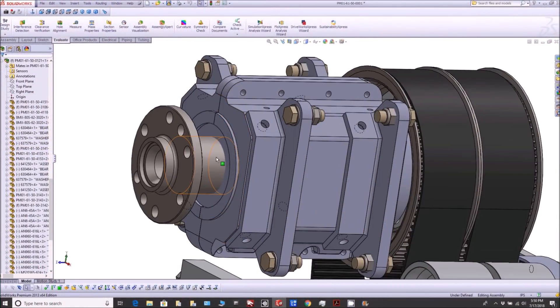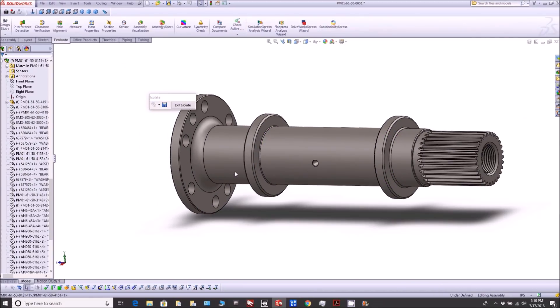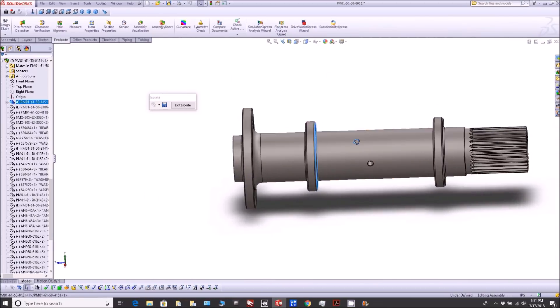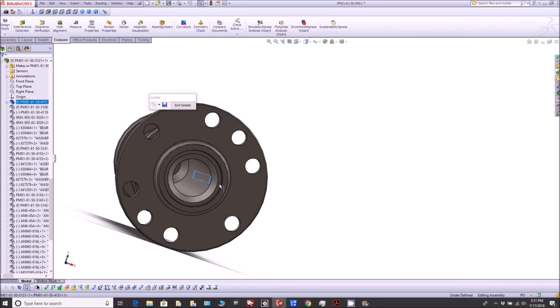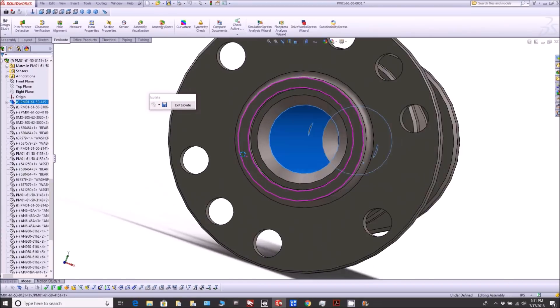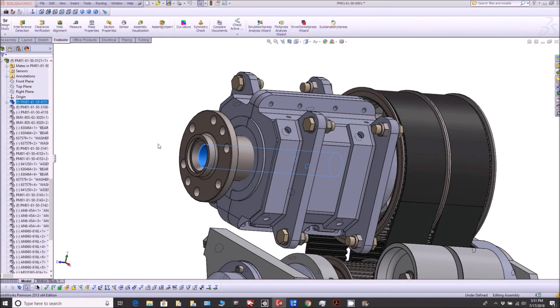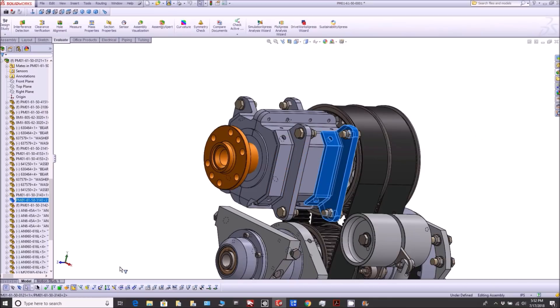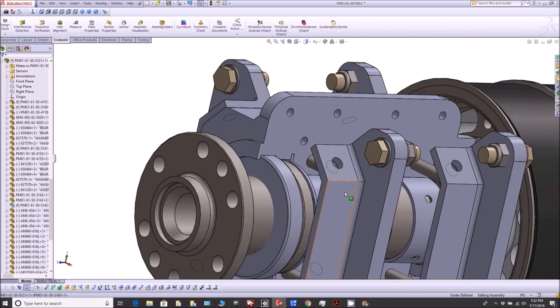Moving on to the re-drive — here's where it looks right now, pretty much finished in terms of all the design aspects. There's the new prop shaft, slightly different than the previous one. These nubs support the thrust — those are the thrust ones, where the thrust washers push up against. There are the oil feed holes, and the oil comes back through the center into the prop for the constant-speed prop. That shaft has been sent off for machining and we should have it back in about six weeks. Mark's finished all the drawings and is putting together the drawings for the housing as well. These are the brackets that will hold it in place, made up with the existing engine mount.